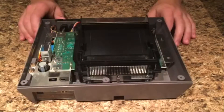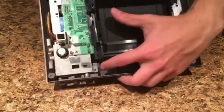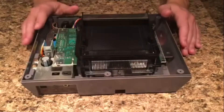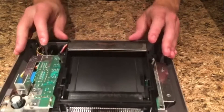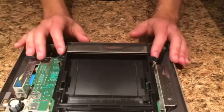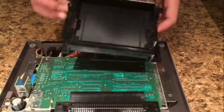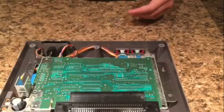This is where things get kind of convoluted. I also took out two extra screws — one here and one where my screwdriver is pointing. They were two regular brass screws, and they're going to be brass no matter what year your console is. Go ahead and take those out too, because it'll get you ready for the next step. Now we're going to remove the cartridge tray. It's going to slide out towards you, towards the opening of the console — you have to lift it up as hard as it'll go and slide it out. It's a little tricky but eventually you'll get it, and it's washable on its own.